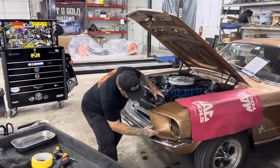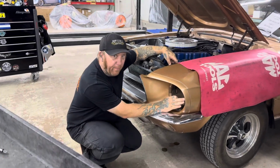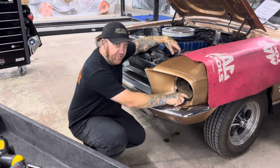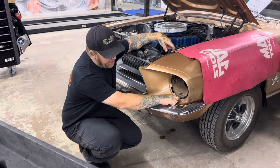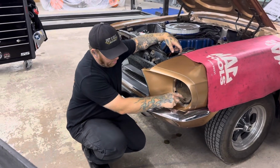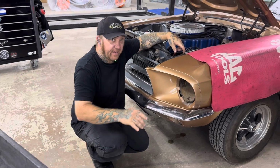What I mean by that is in here you've got your adjustment screws, you got the springs, the condition of the bucket itself. If you're trying to update or change any of this stuff, sometimes this needs modified, and if you have to change any of it or adjust any of it, you're at risk for breaking things if it's old. So you want to look at your headlight adjustment screws, springs, buckets, any of that kind of related stuff.